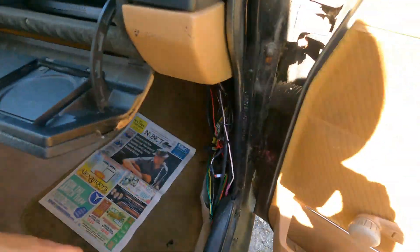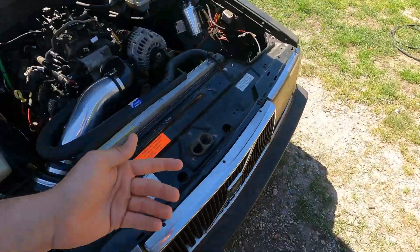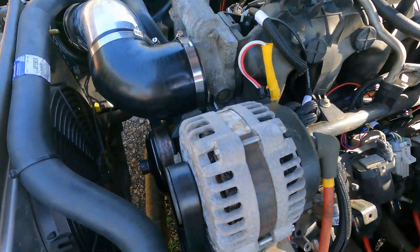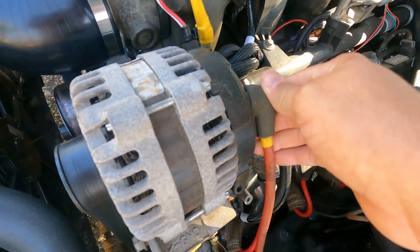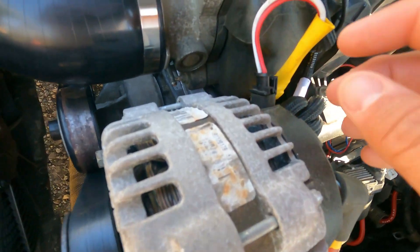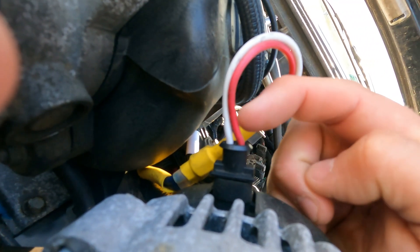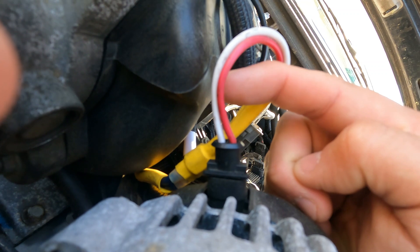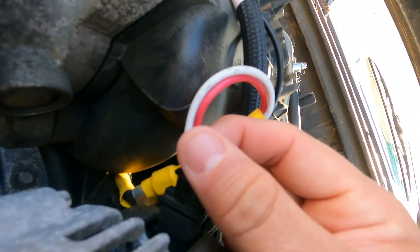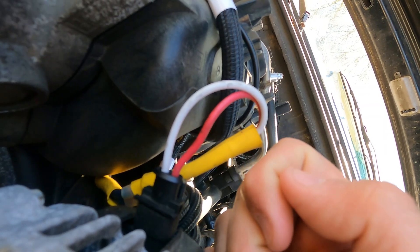It's all disconnected right now so I can show you the path of wiring and how it's connected. We have the alternator here, just a single power wire — this goes actually to my starter. This is the two-pin connector. The wire on the top, the red wire, is the one I'm using. The white wire is routed inside the car but it's not hooked up to anything. You really only need this pigtail with the red wire on the top to go to the little pulse width modulation device.